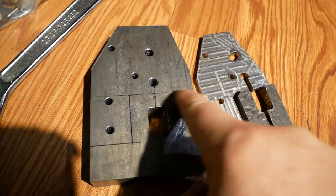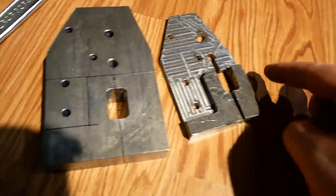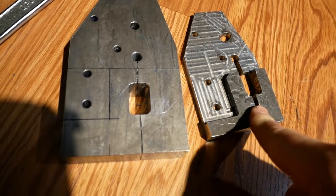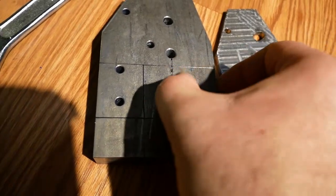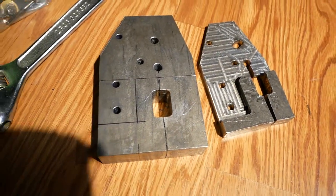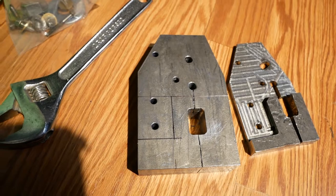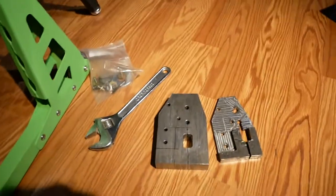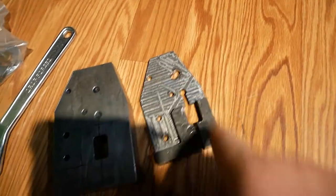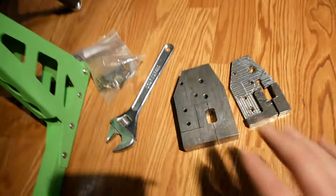So that's going to thicken this critical part up to almost an inch — 7/8 inch — whereas before it was a half inch. So: 4140 steel, much tougher than HRO, and basically doubling that thickness and adding a screw up there. Thumbs up. Please, lords of EVs, let this be the last set of torque arms I ever make for this scooter, because I've already made two. Hopefully those work out pretty well. All the other bolt holes are exactly the same as before — it's just where this section is and how much metal is here, in tougher steel.